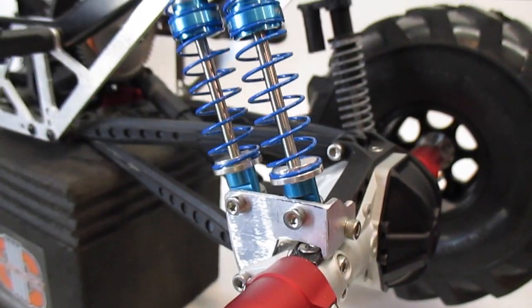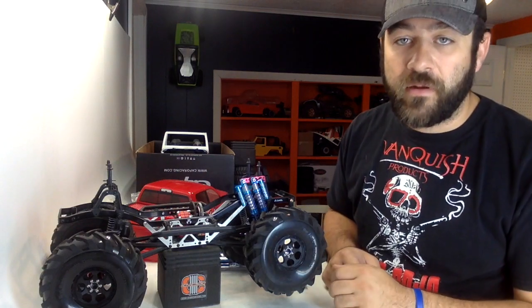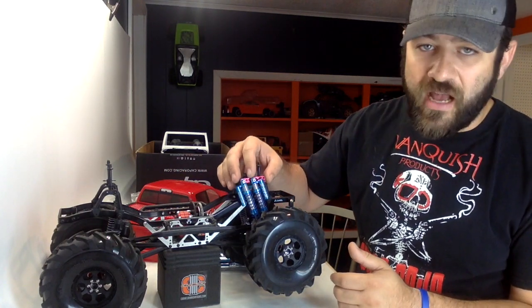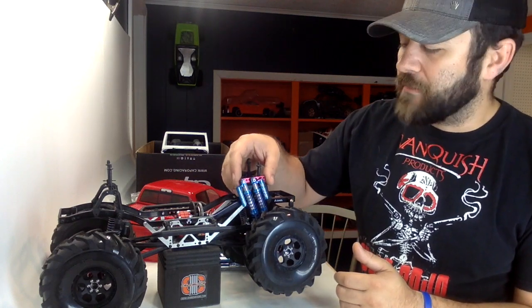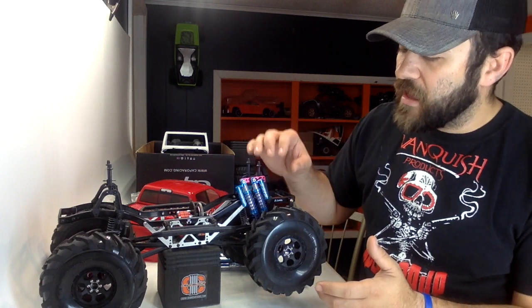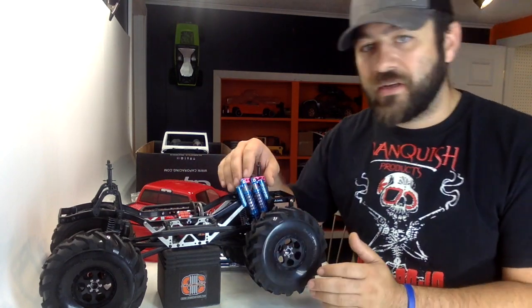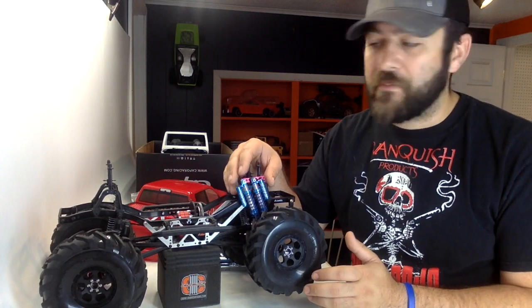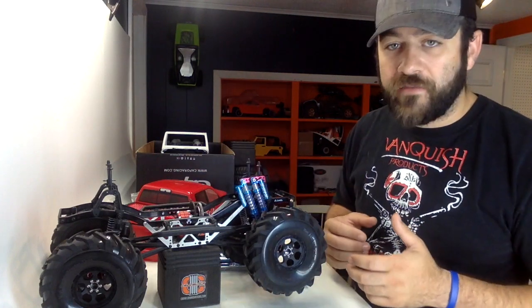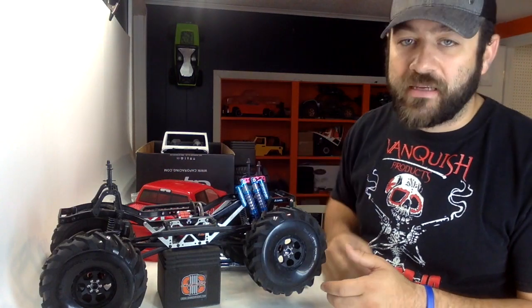I've got my general shape roughed out, and I just keep test fitting, adjusting, test fitting, adjusting until I get exactly what I want. I think I've got that in the rear here already, so I'm going to take that one off and transfer the template onto another piece of aluminum angle and cut that out. On the top side I've got a set of these CBERC shock keys — for right now these are just for mockup, but they work really well for that since they're very adjustable. I'm going to use them to get my shock position exactly where I want it for the end result. In the end I'll probably build some sort of custom upper shock mount, but for now I want to get this mocked up using the CBERC shock keys. With all of that said, I'm going to get this rear lower shock mount taken off the axle so I can duplicate it three more times and get the rest of these shocks mounted on this truck.